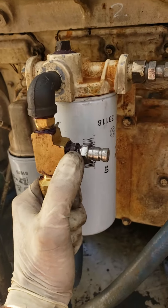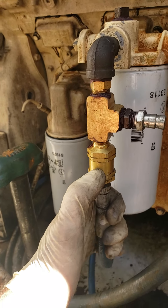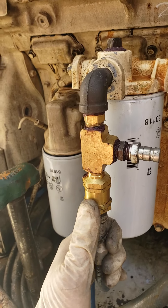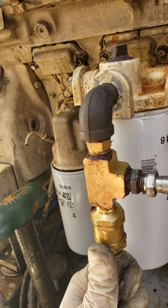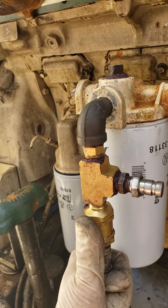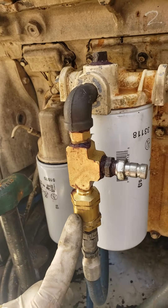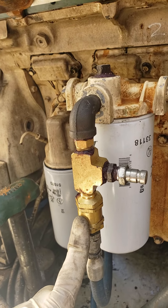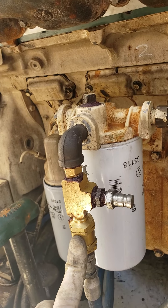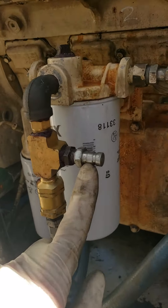I put this fuel primer on — most modern motors will have this from the factory; this one did not. So I put what's called a flat valve. It's not a check valve; a flat valve cracks open at a fraction of one inch of mercury — you can literally do it by inhaling with your lungs. It's not supposed to crack open at 10 inches of mercury or create a fuel obstruction. These are actually expensive — 50 to $75. They use them on municipal buses when parked downhill with fuel tanks on the bottom, where there's so much pressure for the fuel to run back to the tank. They resolve that by installing two of these. This is a universal fuel coupler — I'm going to leave this with the motor.